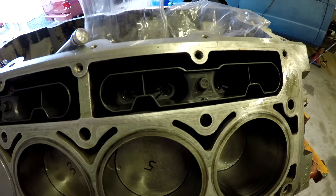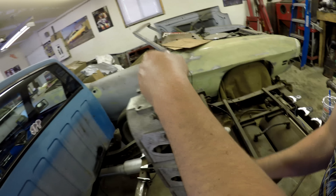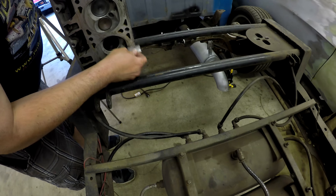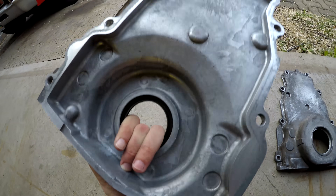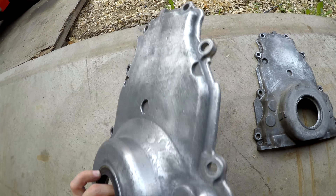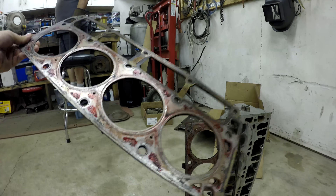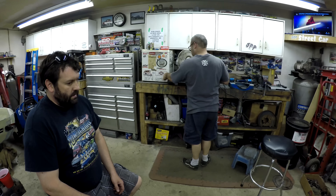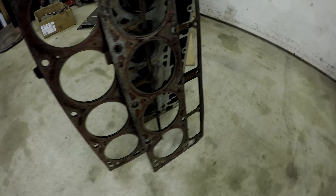This is one case where I'd advocate just going for tight, keeping in mind you're clamping down on plastic — but Mr. Precision over here, you know. Now he's giving the heads a precision deck with a razor blade out on the back of the S10. The outside looks good enough to not be painted and just thrown on the engine. We're going with the head gaskets that came out of this engine — factory LS multi-layer steel — and we always do the Permatex spray on there for a little extra help.